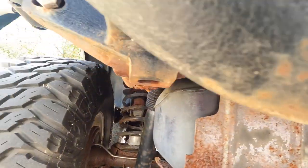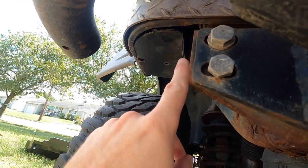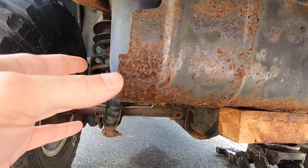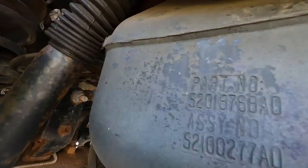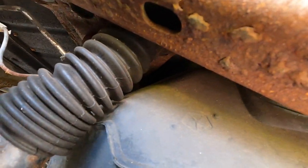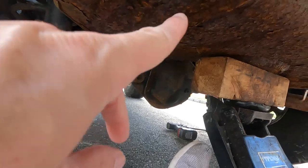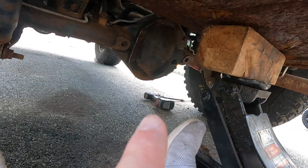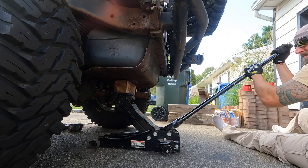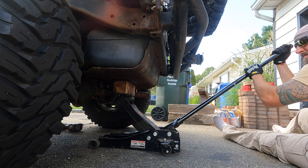And as you can imagine, the fuel neck up here is gonna wanna get snagged up on things. So you kinda gotta lower it, finagle that thing, lower it a little more. Just to get enough room to get up top, you can't really tell yet, but there is a fuel line and there is a wiring harness, so we gotta disconnect them. And just a little advice, when you're doing the front three bolts, or nuts, I should say, an impact gun with an extension does the trick. So let's fight this thing and see if we can get it down.